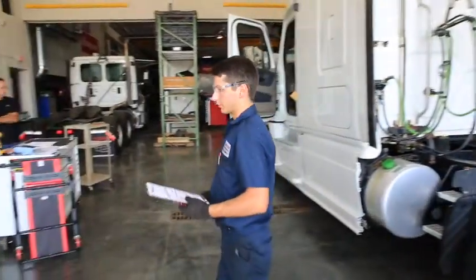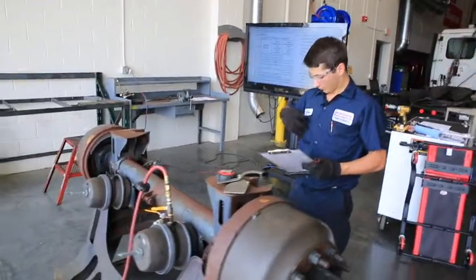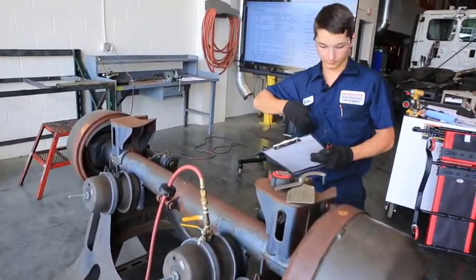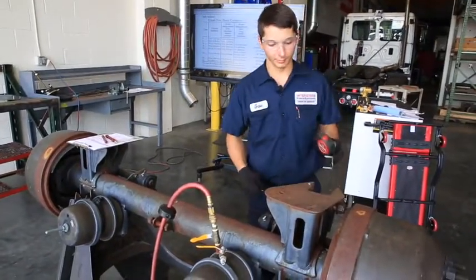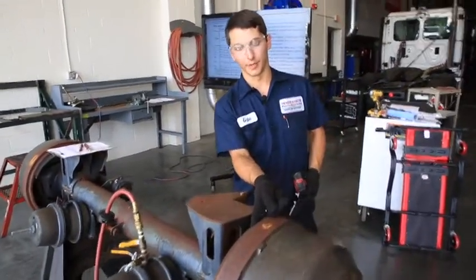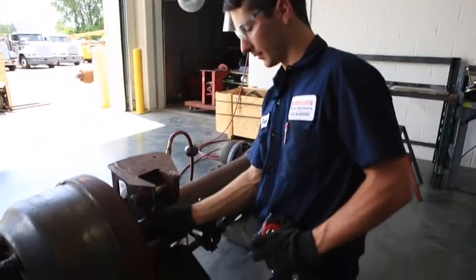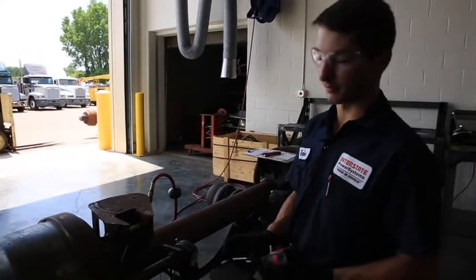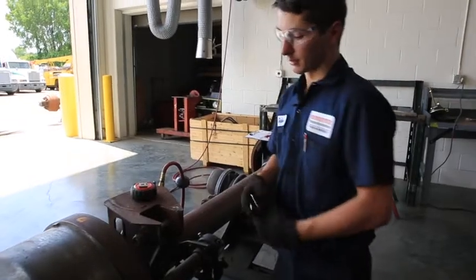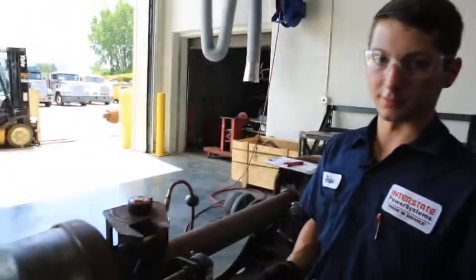When it comes to checking the brake stroke and the brake pads, we're going to use this setup here for demonstration. For the pads, look underneath and there'll either be a wear indicator in the V of the pads showing the quarter inch, or you can take a quarter inch extension and hold it to the pad and the drum. Make sure it's at least a quarter inch for all the brake pads around the truck. Then check the brake drum to make sure it does not show any excess wear on the inside indicating a worn-out brake drum, which would need replacement.